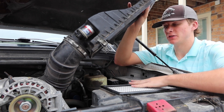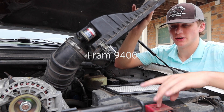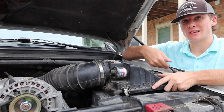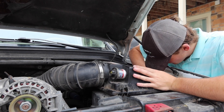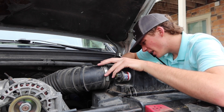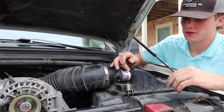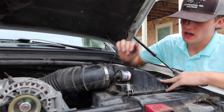I'll leave the link to purchase one down in the description if you guys are looking to buy an air filter — it's the Fram 9400. If you just go to your local AutoZone or Walmart, they should have them in stock. So you put the air filter in, then you take the top here, push it back, and it's got to slide into these grooves right here. Make sure that you clip these down like that. And then this is your air gauge here — to make sure that everything's filtering. If this is plugged up, it means your air filter is plugged up. Mine was plugged up almost 24/7 with my old air filter, so that's why I had to get a new one.